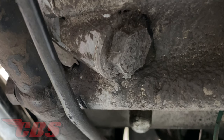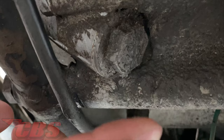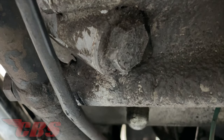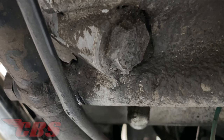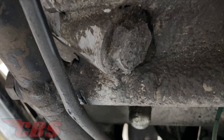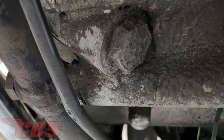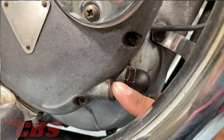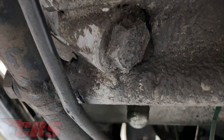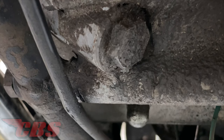The question usually comes up: do I have to bleed the oil system because I removed the oil? When you remove the plug, you're going to see a scavenge pipe. If you remove the oil, there is a possibility that oil may not return back to the oil tank. If that is a concern — which is usually pretty slim — you can remove this plug here on the timing cover. Once you remove the plug on the timing cover, you can kick the engine over. If you see oil dribble out, you know that the entire lubrication system has been bled and it's ready to go.